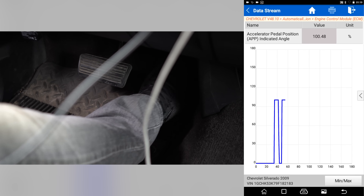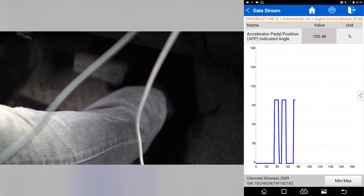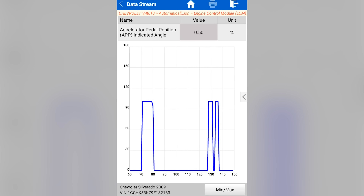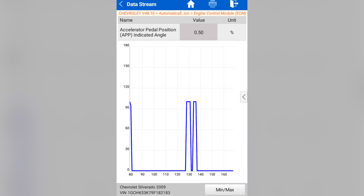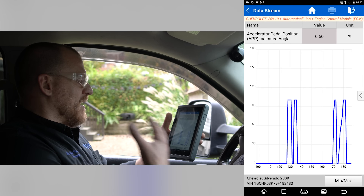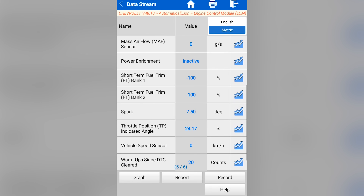No delay in data. I really want to name the company that sent me those scan tools — Caleb, I did this test with like 10 data parameters selected and I counted to 20. I'm not kidding — absolutely useless, you can't troubleshoot with that kind of delay. With all 62 parameters on the TopDon, it's pretty responsive. I can zoom out and look for glitches and dropouts. I'll have to get used to the freeze and record functions.